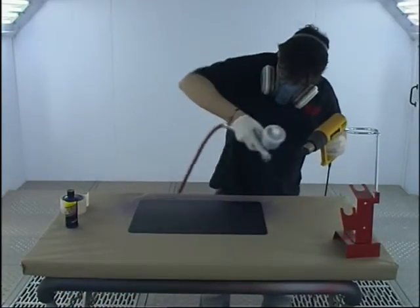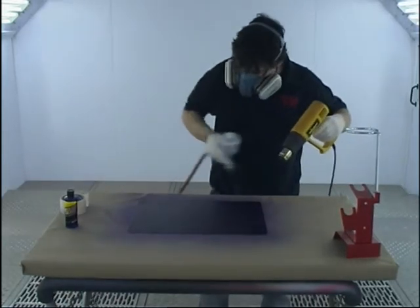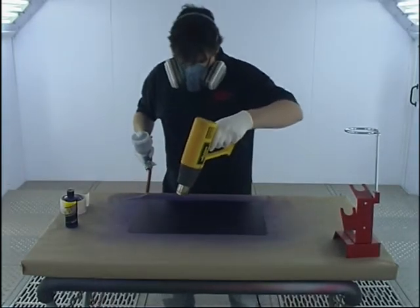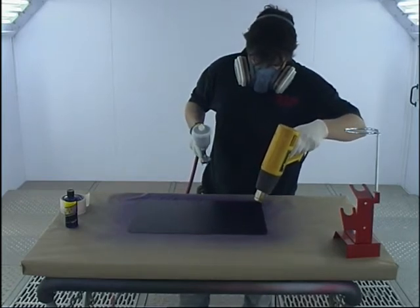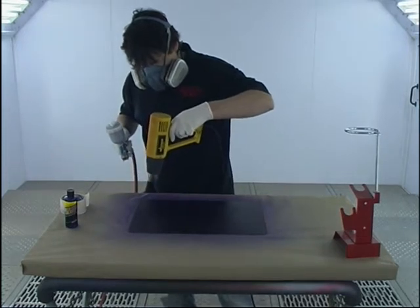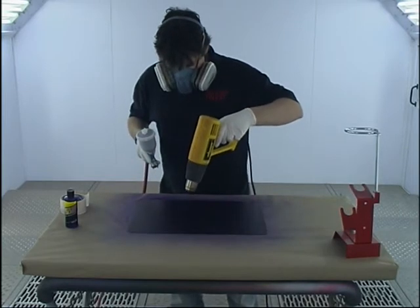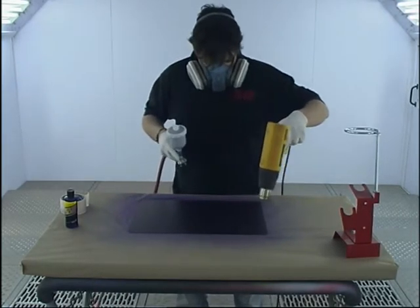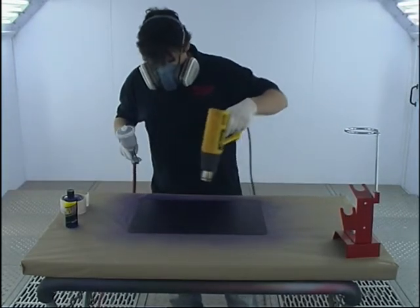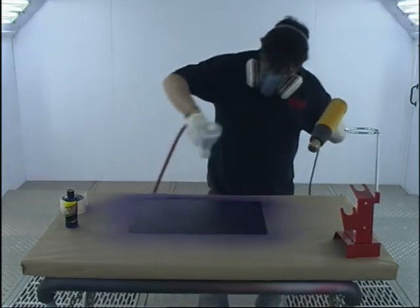The next colour I'm using is Iridescent Purple, and I'm going to put three coats on, again over black, for maximum brightness and ease of use. The fundamental difference between a water-based paint and a solvent-based paint is that a solvent-based paint is a chemical bond, whereas a water-based paint is a mechanical bond. What that means is I can leave this panel indefinitely before I put the second coat on — I don't have to abide by time windows like I do when using a solvent-based paint. I can apply immediately or leave it for a couple of days and then reapply without having to sand. That's the difference between a mechanical and a chemical bond.